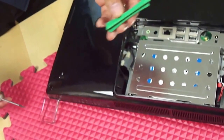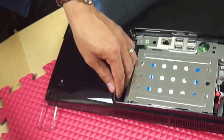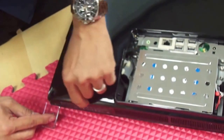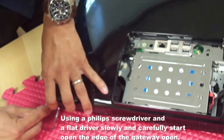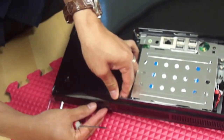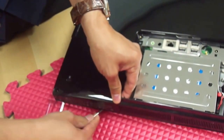This is the hard part. You need to use a Phillips screwdriver and some prying device, which is the Gateway case prying tool. You would then start slowly along the edge — you can see the edge here. You have to be very careful, and you have to slowly snap these edges apart.